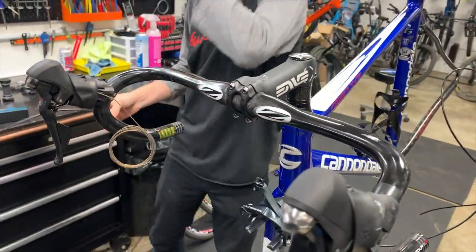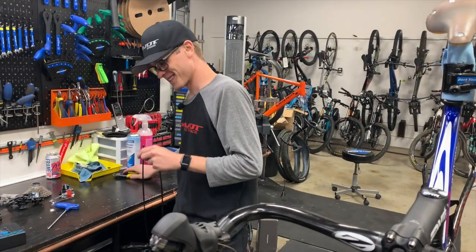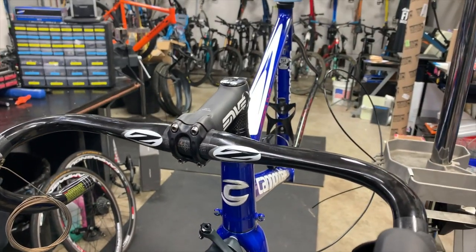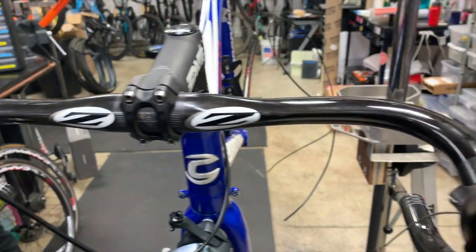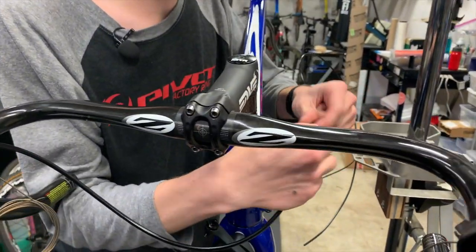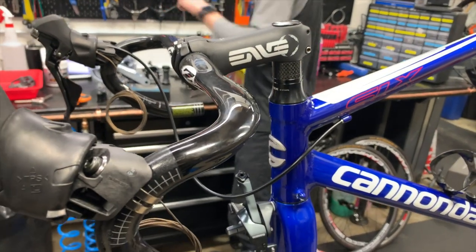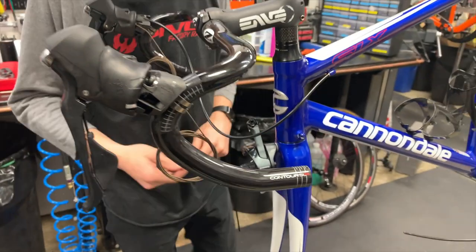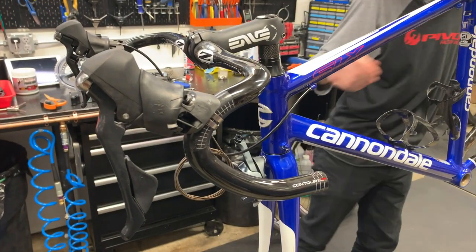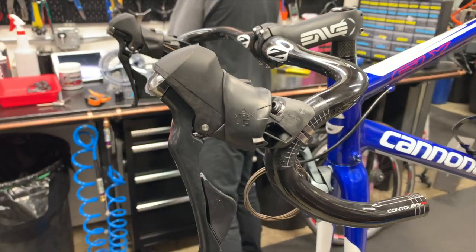I just chose to start here with the brake lines — I chose five mil instead of four mil. So we've got the shifters mounted on the handlebars. They're not torqued down yet — we'll get there. That's usually one of the last things I do, just to get the positioning down once we're on the ground. That's to make sure that the bars are level and have the correct curvature and relativity to the floor, as well as the shifter position for your hands on the hoods — a nice flat surface rather than having either one of the shifters too high or too low.